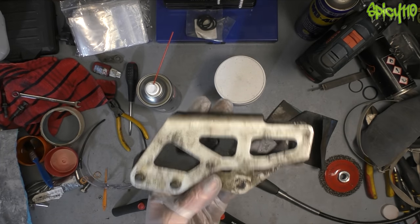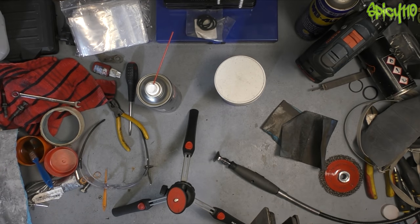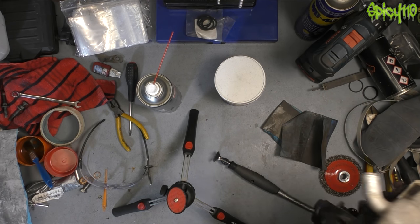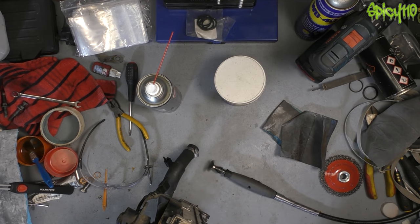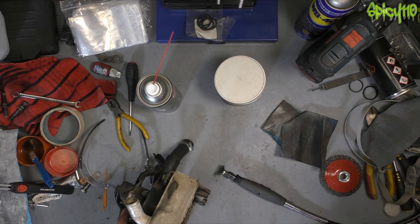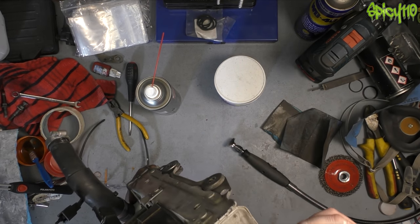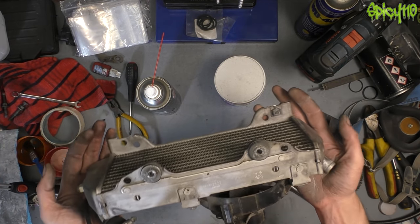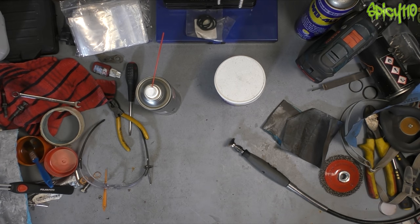I also need to clean up this chain guard — I'm just going to chuck this in paraffin overnight. The plastic will be fine; it's got so much caked up grease on it. The radiators could do with a bit of cleanup but I'm not quite sure how I'm going to do that — maybe the wire wheel, a little one, very lightly. The metal on radiators is not very thick, so I just want to take that scale off. I'm tempted to re-spray this housing because there's a bit of rust on it — I'll see about that.